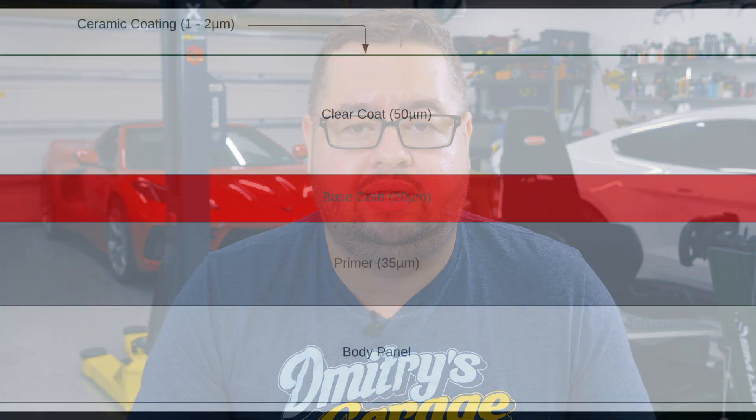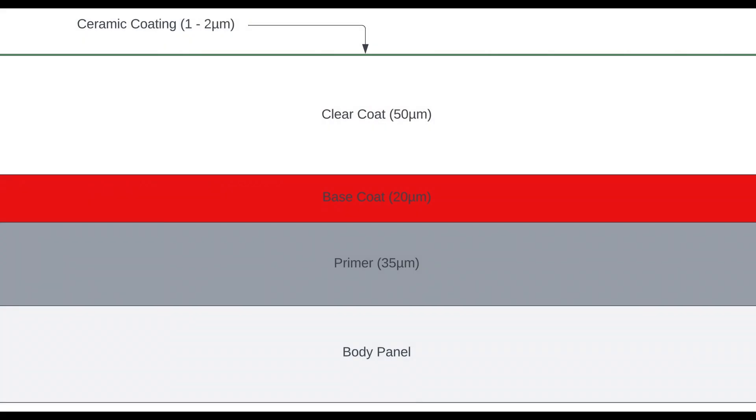We can conclude that not all products can truly achieve hydrophobicity. I also suspect some manufacturers are reporting the highest value they can generate on a test rather than an average — most marketing doesn't say 'average,' just 'up to' or a single number. On average, we just didn't see any product reliably beating or matching some of the high numbers we sometimes see in marketing material. The substrate matters a lot too — coatings, waxes, and sealants are incredibly thin layers, so an imperfect substrate, one that isn't well prepared, has wear, contamination, or a different paint system, can all affect the final reading.